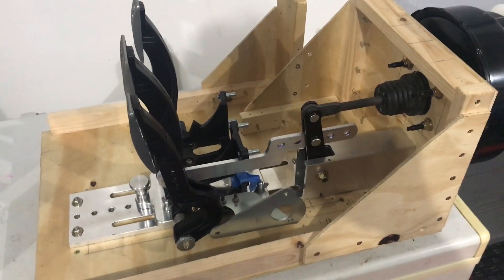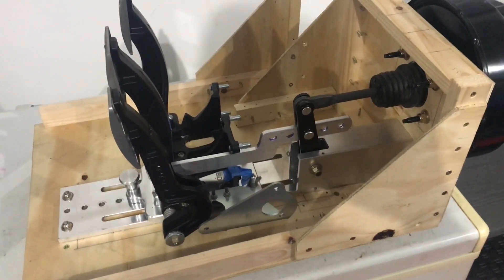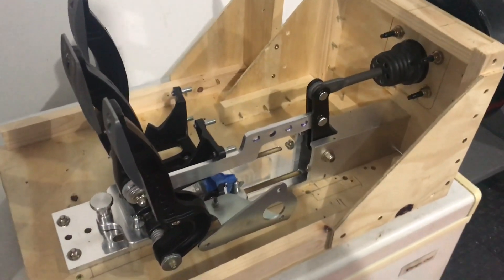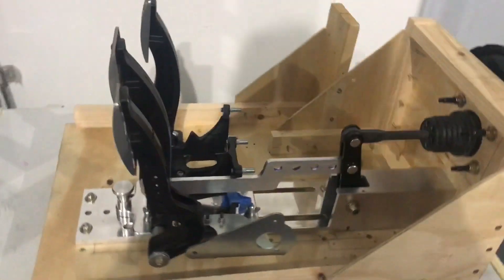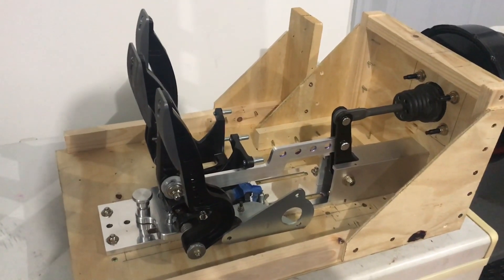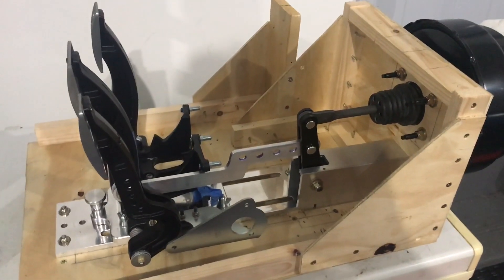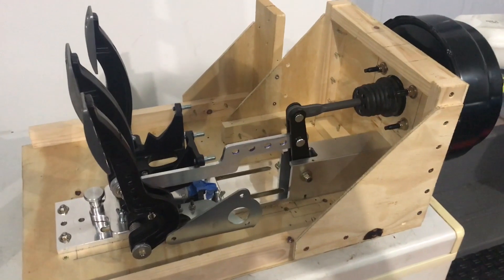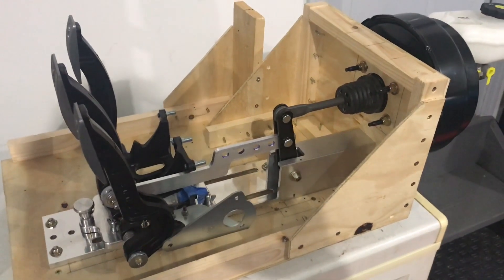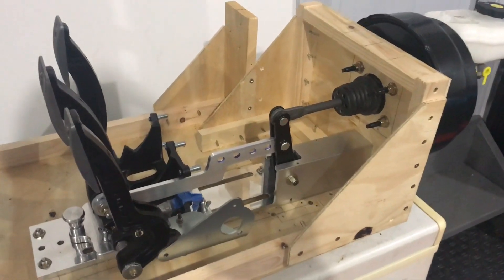For the last segment, I'll show what it looks like with the pedals moved closer to the driver. You can see the pedal assembly is now two inches closer to the driver. I have basically two inches of forward and two inches of rearward travel in this system relative to where I think the pedals will be ideal for me, which will be nice for accommodating other drivers of the super light coupe.